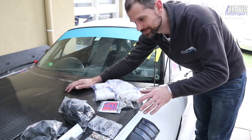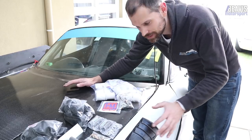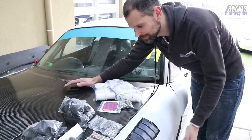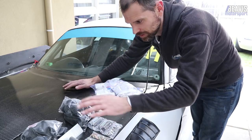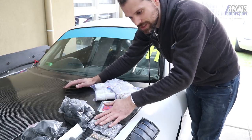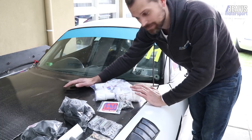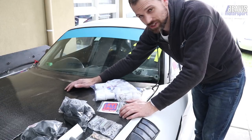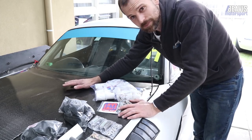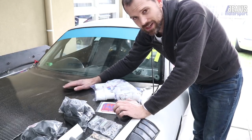This is a lot of bits. Suspension bush changes aren't exactly easy, particularly getting old rubber bushes out after 20 years. Thankfully because these bushes aren't insanely old and they're poly, hopefully they'll come out fairly easy. I've got the Delrin bushes and sleeves from SADFAB, the poly bushes with bronze sleeves, the Zerks for lubing, the washers, plus the awesome gear from Matty with spare Delrin stuff to play with. For now I'm going to keep it simple and just install the SADFAB kit in its standard form and see how it works out.